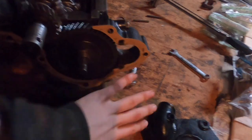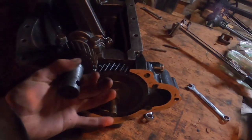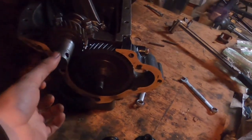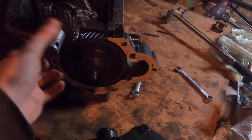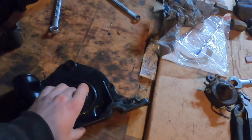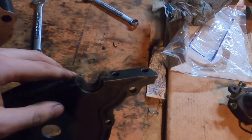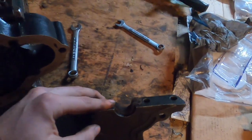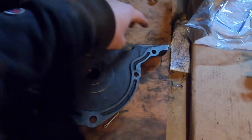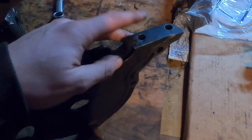It's recommended to put the front plate on before you put the engine in because of the crank seals. This is the edge of the crank that comes out and there's a seal that goes around here to seal the oil. Originally this oil seal is a piece of felt — a half piece that goes in the top half, and the matching half is on the pan in the car. You cut a round piece in half and push each half in — it's soft, movable felt.